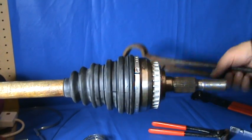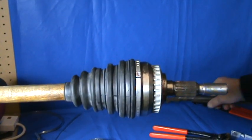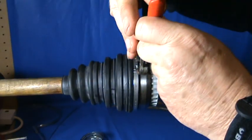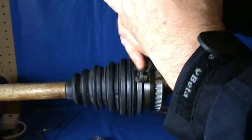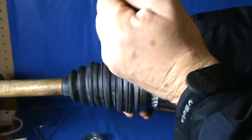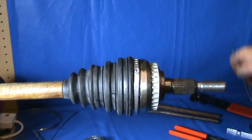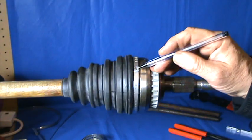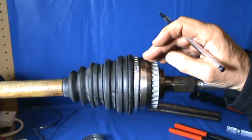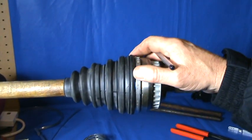At this point it's easy to go down to your grandad's shed and find the biggest pair of pincers you can, but you don't actually need them. You can crimp this with a normal pair of nail pincers or tile cutters — whichever. Just put it over this section, hold that bit down and crimp it in. That's now not going anywhere. The idea of the dimple here is important: it reduces the height of this crimp, which on some cars is important because the crimp can actually damage other components around the hub.